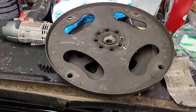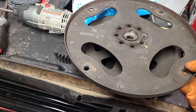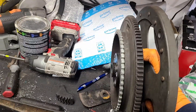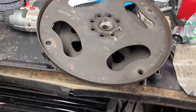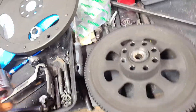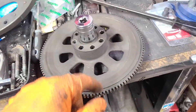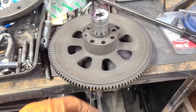I had to re-upload the video because one thing I forgot to do — which meant taking all this apart — was remove this flex plate adapter piece. You still want to keep the trigger wheel and the starter wheel, but you have to get this piece off the assembly because the adapter kit was not manufactured with this piece in mind. It came off really easily — I set it on a 28mm socket and hit it off from behind with a punch and a hammer. It has to be done so that when you install your kit, it has the correct spacing.